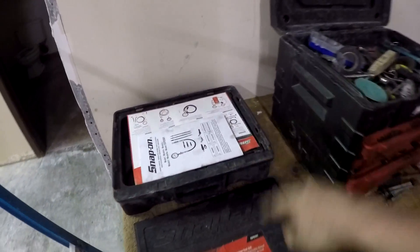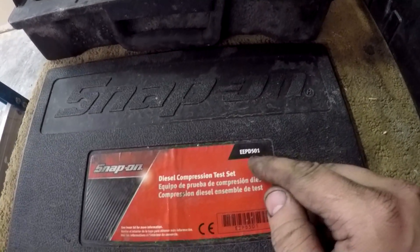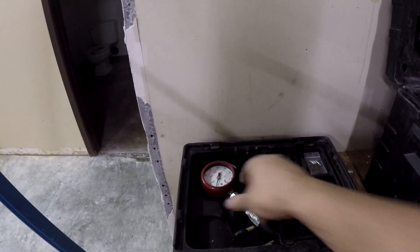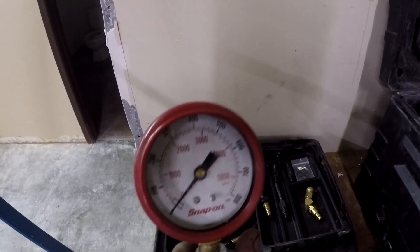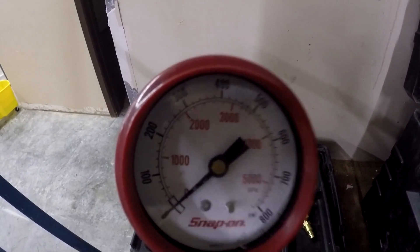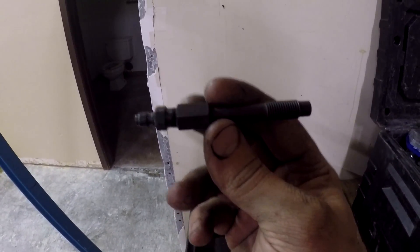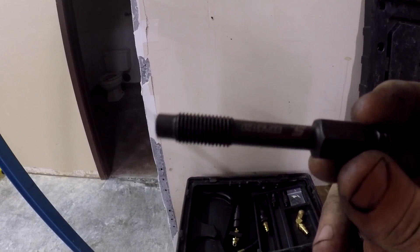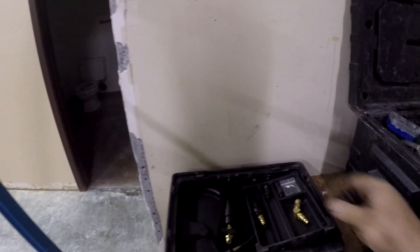Now that I have all the injectors unplugged, it's time to break out the compression gauge. The one I'm using is a Snap-on EEPD501 — just a general diesel compression tester set. It's important on these diesels that you have a gauge that goes up pretty high; this one goes up to 800. I'm hoping to see around the 350 to 400 range — with this old of an engine I'm expecting around 330 to 350 on all the cylinders. The adapter for the glow plug hole on a Duramax has a thread pitch of M10 by 1.25, and a lot of people online sell adapters that look like a glow plug and thread right in.